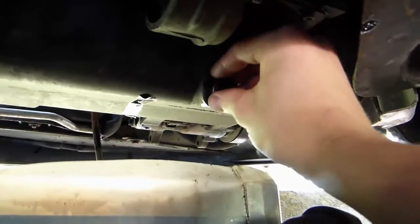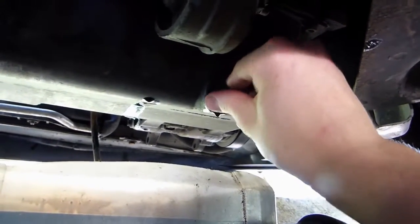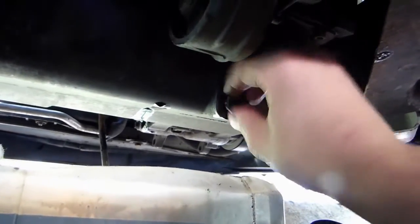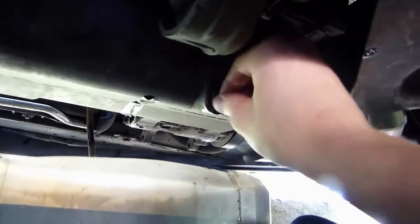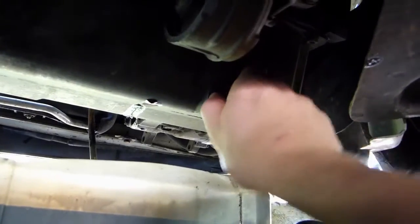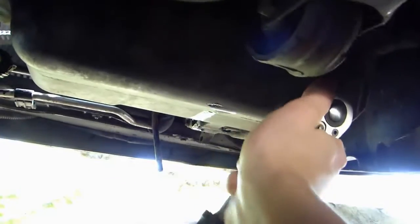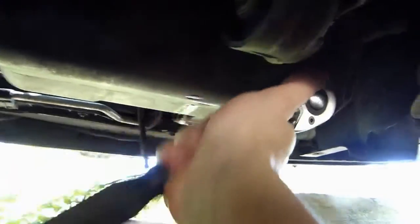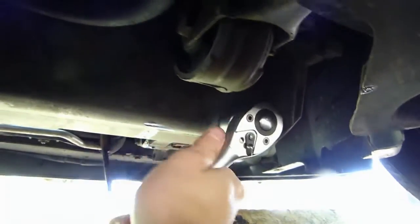Okay, so screw it fully on by hand, because you really don't want to put it on sideways or force it with a key and ruin the plug. So just screw it on by hand, and when you can't do any more, you're going to tighten it with the key. Tighten it well, but don't tighten too much. You don't want to break anything.